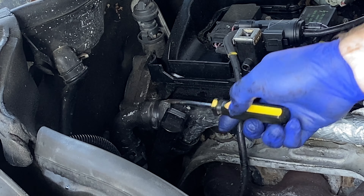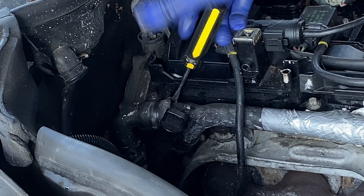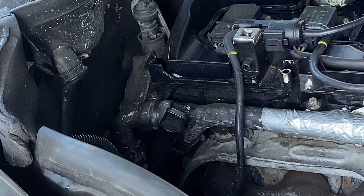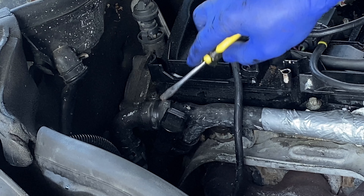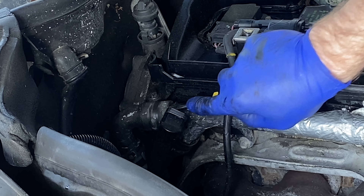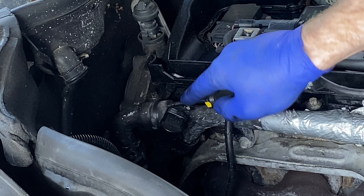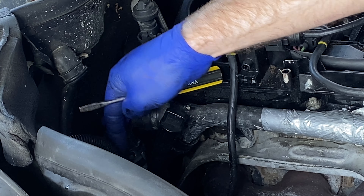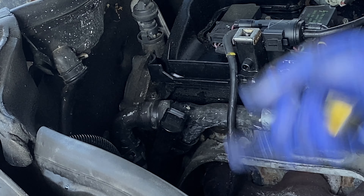At this point, if it starts to just come right up like this one is — I don't even have to do much, barely touching it, two fingers — great. If you have to force it, get some white lithium grease, WD-40, or a little bit of used oil and put it around where the seal is, then try to get your screwdriver in there again. You'll be pushing some of that oil under the rubber and it'll soften it up so it slides off. If the hose goes somewhere under the engine where you'd have to jack the car up, you really don't want to force anything.